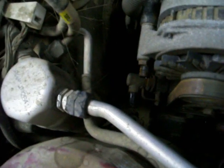Just a little tip: when I drain the coolant, I always like to leave the pan underneath there, because there's always more somewhere in the block and further up the system — you can never really drain it all. What I did was I took the heater hoses off and of course it started draining again, so I had my pan under there to catch it all or at least most of it. A little tip for taking these off — these have the squeeze clamps. You get those off and then they're still stuck on there pretty good, but I like to take the channel locks and grab onto them and try to wiggle them free. Another way to do it is take a pick and get behind there, loosen them up. Pull them off — sometimes they can be pretty stubborn, sometimes you do have to cut them.